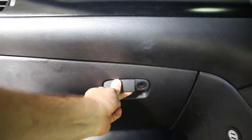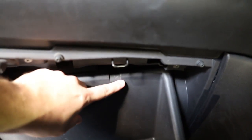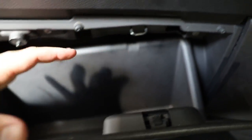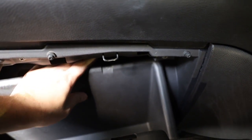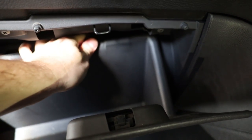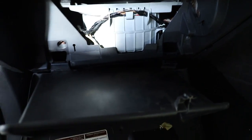If you have a look just here, you'll find a little tab just in behind there, and when you push down on that tab the whole glove box will drop downwards. We're going to get that and push it down — you'll probably need two hands to do it, it's pretty tight. All right, so once we've got that down...